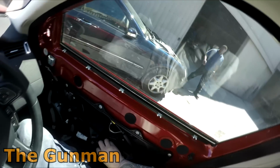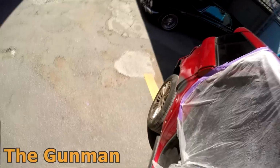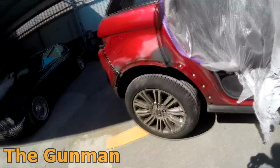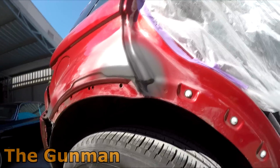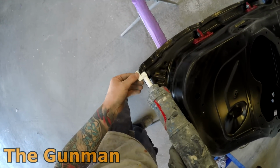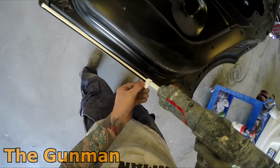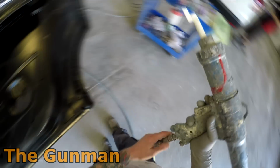With that UV primer, there's no reducer required, and again, I do have a specific review on that UV primer too, so if you'd like to check that out, you can look through my channel. But basically just put 2 coats on. You don't want to overdo it, and then you whack it out in the sun. Specific UV primers need a specific light to cure, but the Metalux one that we're using is quite fine just curing in the natural sunlight.